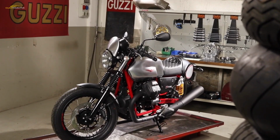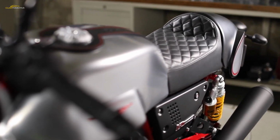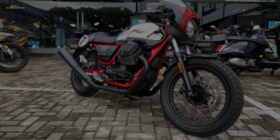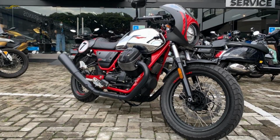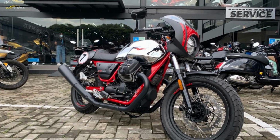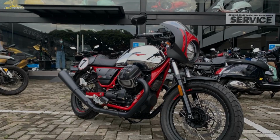The most recent update includes new heads, cylinders, and pistons with dual pushrod-actuated valves in each head. Euro 4 emissions compliance was also a front-burner topic, and the factory achieved it through the double O2 sensor, catalytic converter, and secondary air inlets in the heads.